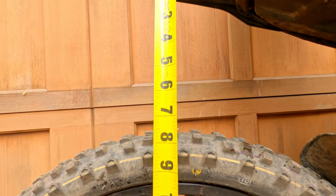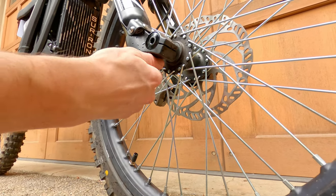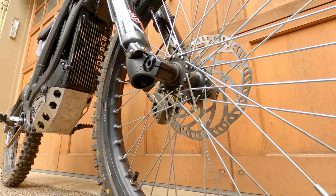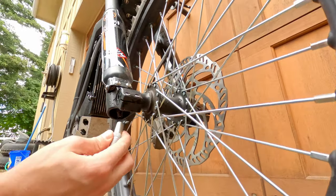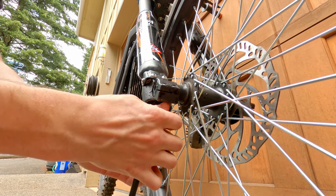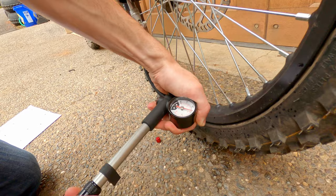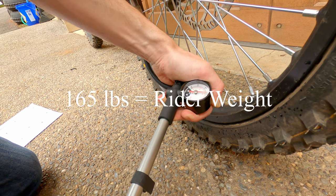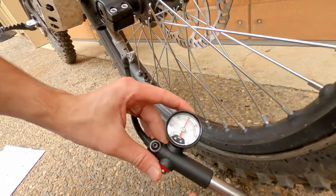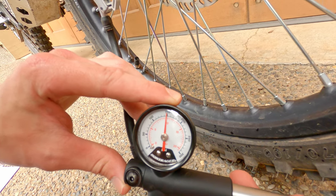After the next reading, we nailed it and are at exactly 20 inches. Under the non-disc side of the fork there will be a red valve cover — this is the main air chamber. Remove the cap and attach a high pressure shock pump; a normal tire pump will not work for this. Our starting pressure was a bit under 140 psi. We felt the fork was soft at 165 pounds and pumped it to the maximum recommended pressure of 150 psi. Note that while unscrewing the pump you lose some pressure, so add roughly 10 psi more than your desired pressure to compensate.